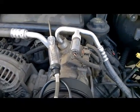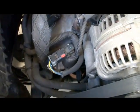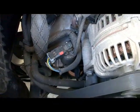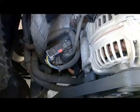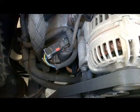So in this case, like I said, this is a power side switch. My test light is connected to battery positive. I have already my T-pin connected to our EGR signal. So next thing, I'm going to put the key on, engine off, and then perform this test.